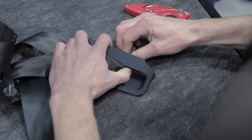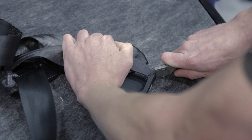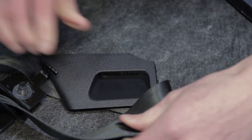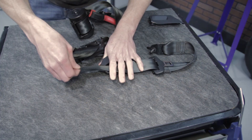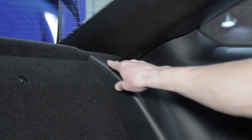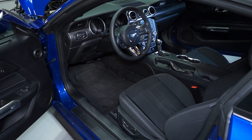Use a sharp utility blade to cut the corner of the rear seat belt trim piece. Be sure and position the belt out of the way. Once the cut has been made, slide the belt out of the trim piece. Do this for the other side and then reinstall each modified trim piece back into the car. If you removed your front seats in the beginning, go ahead and reinstall those.